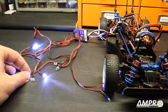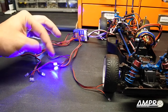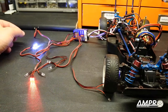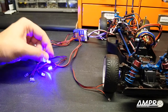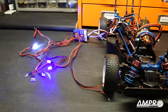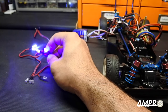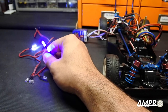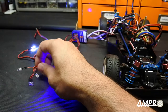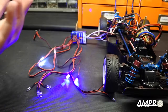I'm still trying to figure out a practical use for those. I suspect if you want to put them in as a fog light or auxiliary light, that's fine. These come on at neutral, and I suspect when we hit the brakes — okay, so we're going to have a neutral light and then a brake light. What I'm thinking is you would wire these in as red for a brake light. When the vehicle is stopped in real life you'd have your foot on the brake, and if you slam on the brakes or go backwards, you could use the others as a reverse light.